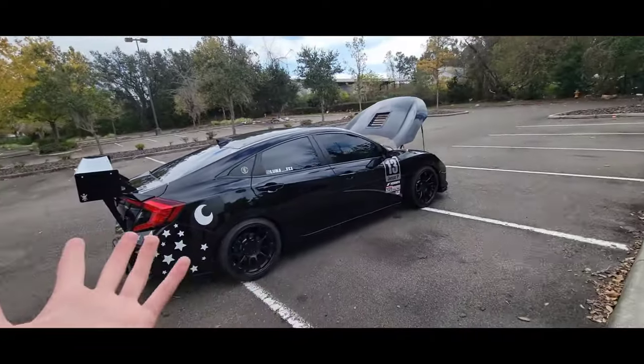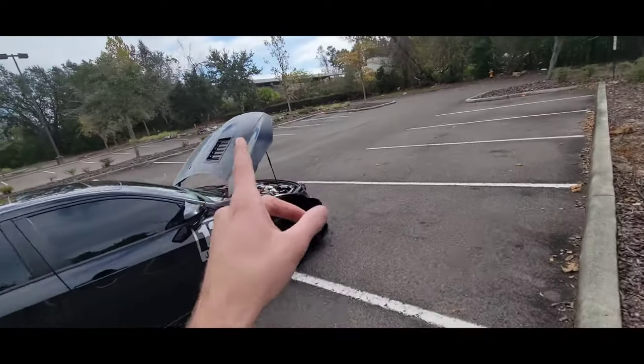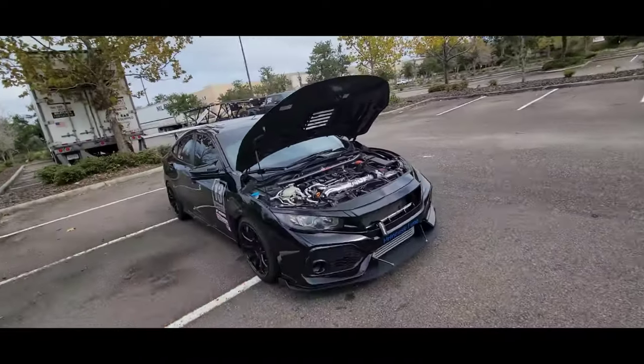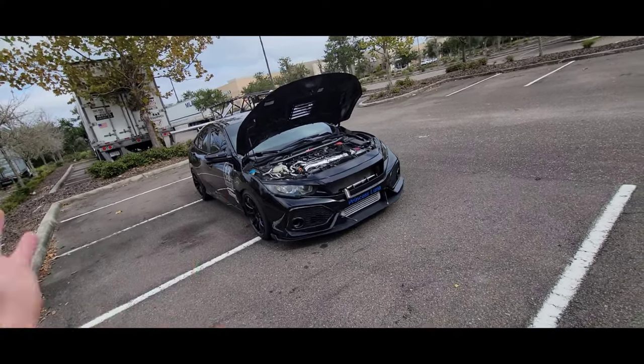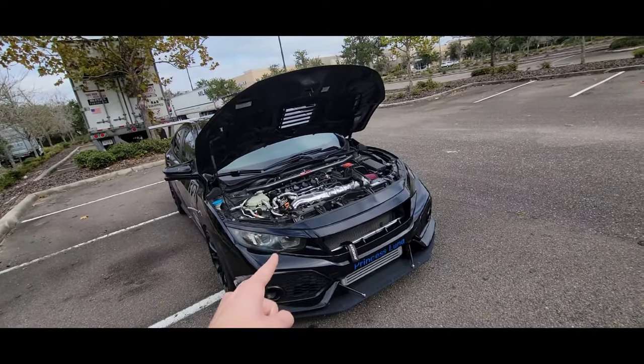Thirty pounds per wheel is a lot, considering you can buy wheels that are 10 pounds lighter for not that much money. These wheels retail around $900 but I got them for about $670 — and for that you gain a lot of performance just from the wheel swap. Coming back to the intercooler: for the 10th gen Civic especially, if you're boosted that is really essential. The heat soak on these cars is terrible — do like three pulls and the car just doesn't want to go anymore.